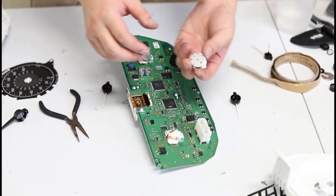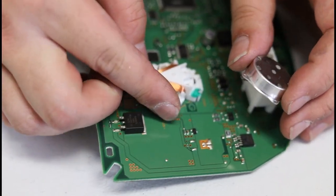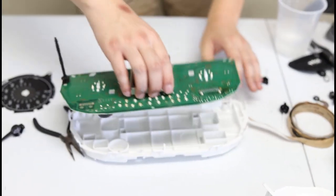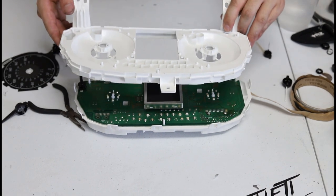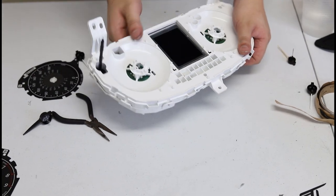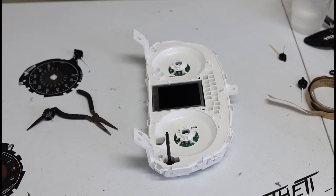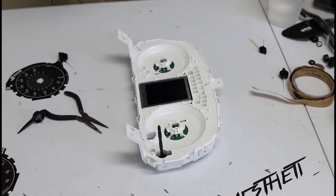The hard part is now done. Take your hot glue or butyl tape, place it on the three corners, put the metal cover back on, and reassemble everything. Now whether you got lucky or unlucky with the shafts, you should be at the same point — gauge faces removed, needles off, motors reset if needed — and you're ready to put everything back together.